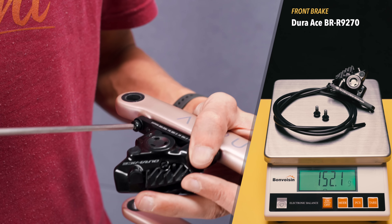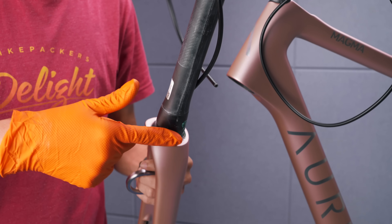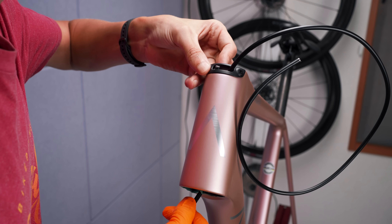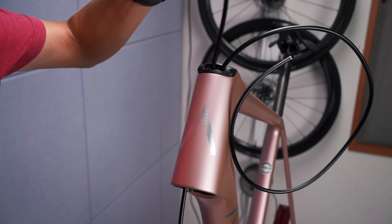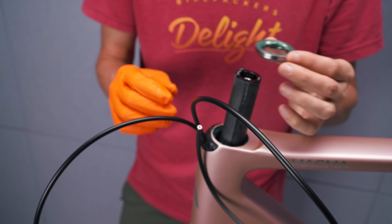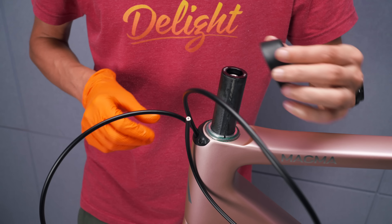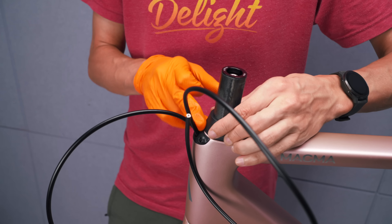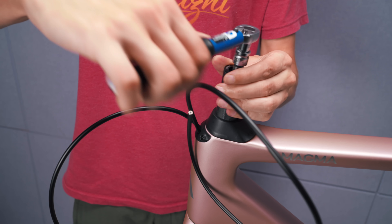Loosely attached the brake caliper to the fork and it was ready to get installed into the frame. Some prep for the frame and the fork with grease, then the bottom headset bearing on the fork, and a little more grease for good measure. Some more brake hose fishing through that head tube opening. I put a little mark on the front brake hose to know which is which, especially since Dara has his front brake on the right lever, which I need to remember. Prepping the upper headset bearing seat before sliding the fork all the way into place. Top bearing on, followed by the split ring, and then the headset cover. At this stage I had already flipped the frame around on the stand and was now attached by the fork.